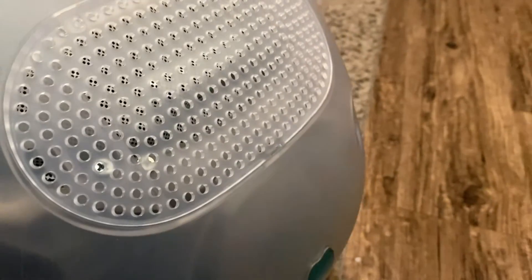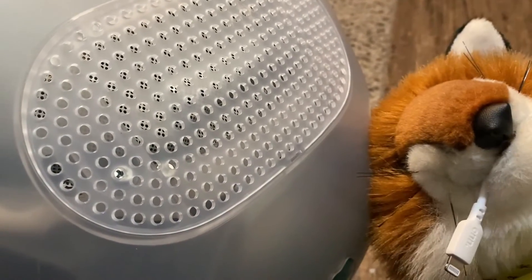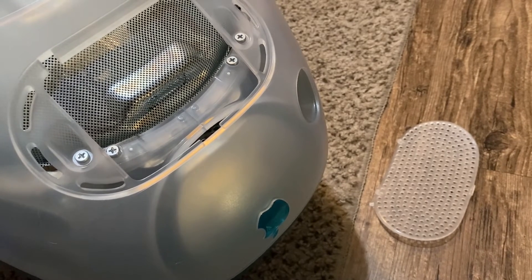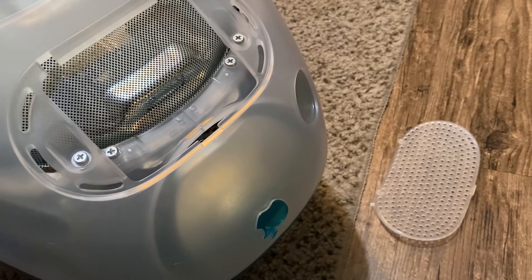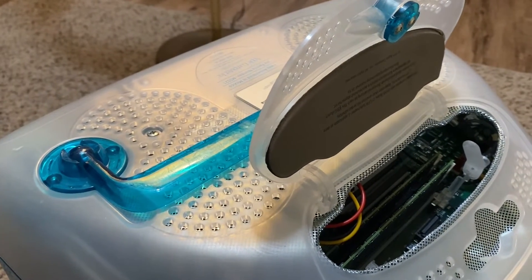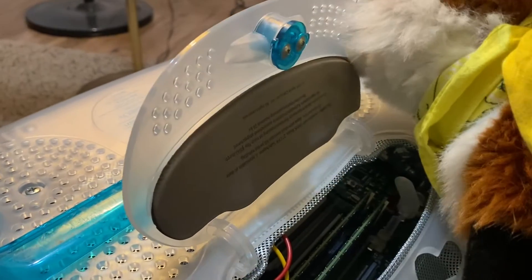Next, you're going to notice a little door at the bottom — it actually opens just as easily with a Lightning phone cable as well. Once it's up, you'll notice four screws. You'll want to take care of these usually in alternating order, because there is a lot of pressure on these screws. Once they're all out in a safe place, you can go up to the top of the device and you'll notice two little screws right by the foot of the device — you'll want to take these off too.